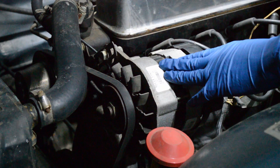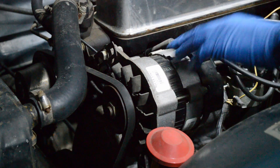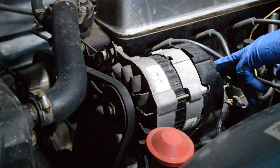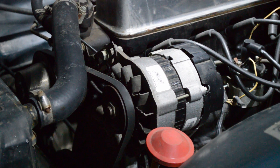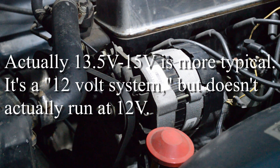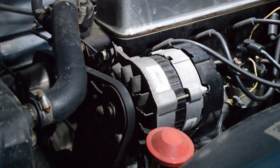So it's the stator that is making an alternating current. Inside the back of the alternator you've got what's called a rectifier — or more accurately a diode pack in these cars. Alternating current is not what you want; that's where you've got positive, negative, positive, negative. We just want a straight 12 volts — actually a little bit more, but you want enough voltage to charge a battery as direct current, meaning only a positive signal. The rectifier's job is to cut off the negative side so all you get is positive.